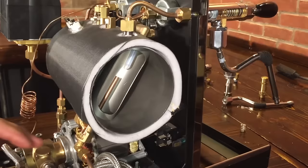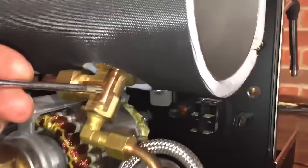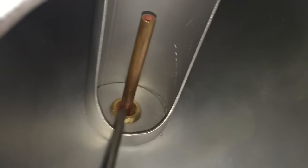When you're brewing, the water comes through this tube, out here into the heat exchanger, pressurizes this, which forces water up through this tube and out to the brew group. They go to the center of it so you mix the water — you always keep it mixed. The water coming through the thermal siphon comes around the edges of that tube, not through it. Water goes up and just keeps circulating.